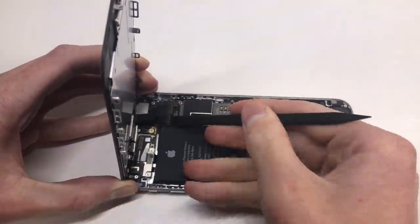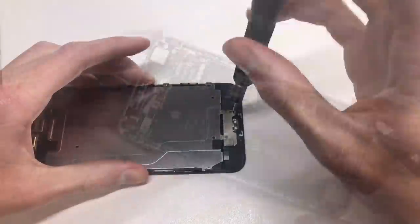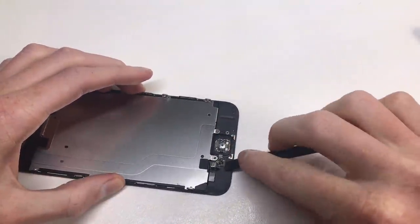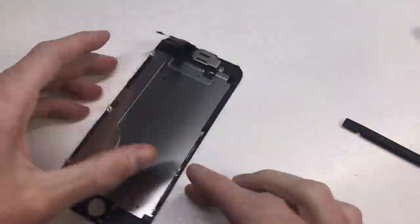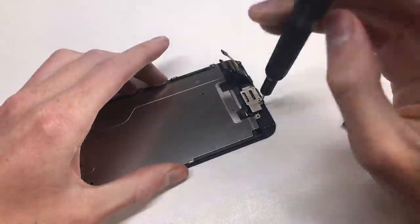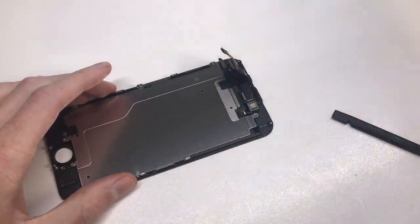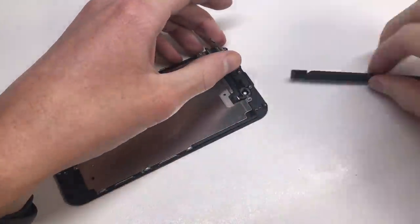Obviously when doing this, make sure to disconnect the battery. I say it in all my videos and it's one of the most important things you need to do before disconnecting the display. I know of many people who have fried backlights just because they're too lazy to disconnect the battery — it's only two extra screws and a clip, and you can avoid frying your entire iPhone.